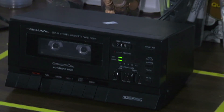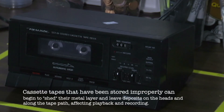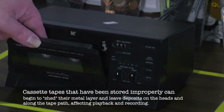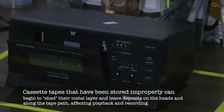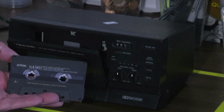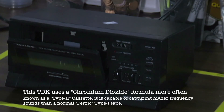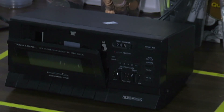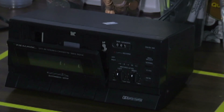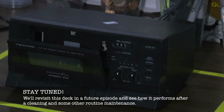Somebody was making recordings, they all turned out like garbage, so they got rid of it. But it also could be the tape. I'll have to try this test recording with another tape. I did use a fairly good tape — this is a TDK SA-90, a chrome tape, and I've always been happy with TDK recordings. But maybe this is a bad one or it's got some kind of damage on the tape that I didn't see earlier when I pre-wound and checked it out. Doing a quick inspection on the inside of this tape transport, it doesn't look too dirty, but obviously something's wrong. So I'll stop this for now, I'm going to go clean this cassette deck, grab a different tape, and try it again.